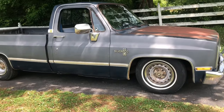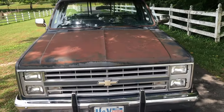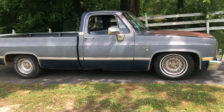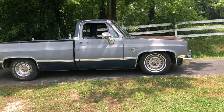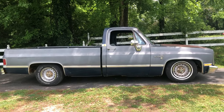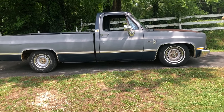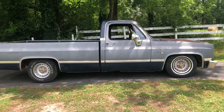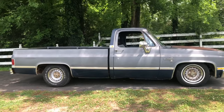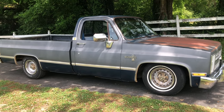Here it is done. We just drove it and with those inner fenders out it's still rubbing just a little bit on the driver's side, so we're probably gonna change wheels and tires anyway. It does rub just a little bit on those 235/75 15s on the truck rallies. That's a coil and a half off the front plus two-and-a-half-inch drop spindles from China - they were $215. Then flipping the rear axle was $15 to do that. For $230 we lowered the back five inches and lowered the front like five and a half to six inches. We're going to keep working on this truck and you'll probably see another video.